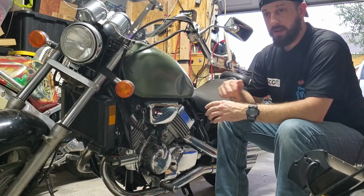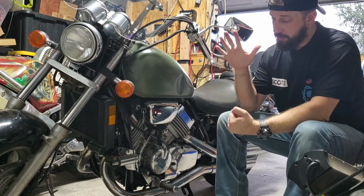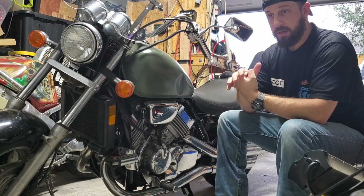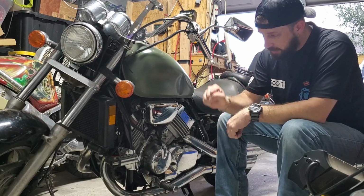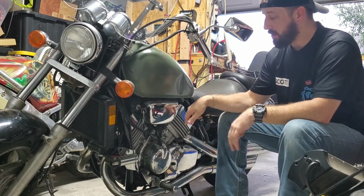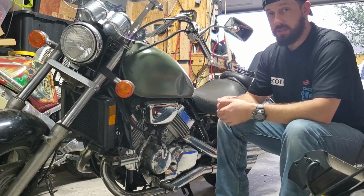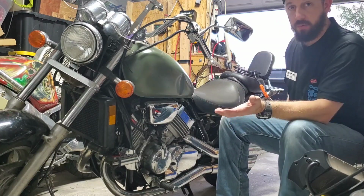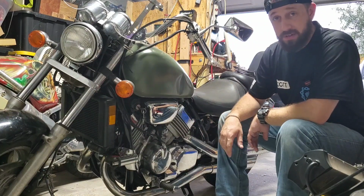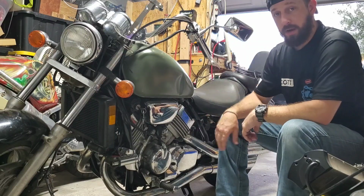It's steam cleaning the top of that piston, because fluids don't compress, and whenever you're using a piston to compress the air inside that cylinder for an explosion to happen, those molecules get compressed as well, and they act like little hammers. They break apart that carbon on top of that piston, and then the superheat of the explosion turns that liquid to steam and it goes out your exhaust, which creates a white smoke. So what I want to see is my coolant in my engine steam cleaning the top of my cylinder. So I want to check all four of them. I want to see their condition, and we'll go from there.